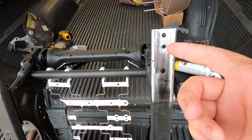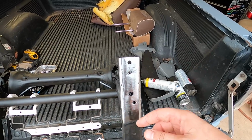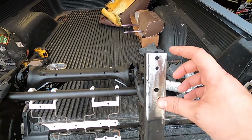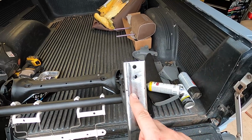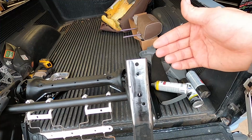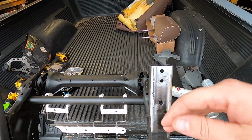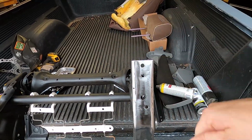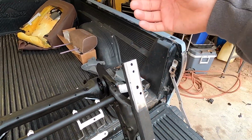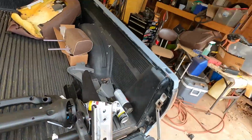So anyways, that's where you're going to spend most of your time, is cutting that piece that sticks out, cutting that off, because I don't know if it's fused to it or what, but you can't just cut a certain amount and then it's open and then chisel it out. Y'all saw me using the chisel. What I was doing was basically scoring it a little bit, chiseling it, cutting that off, and working my way farther and farther into it. But basically, you pretty much just got to grind it. Even Todd said most of the ones he does, he just burns up a whole flappy wheel and just grinds it to death.